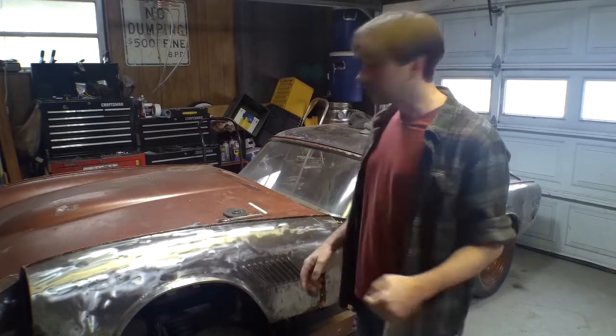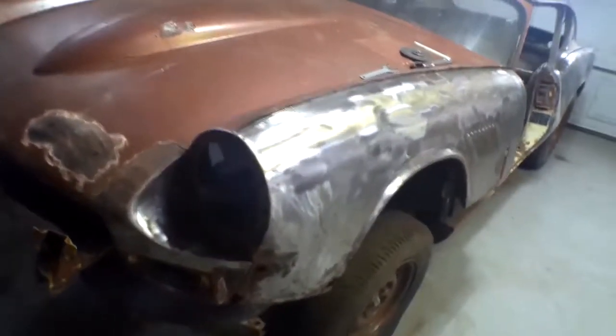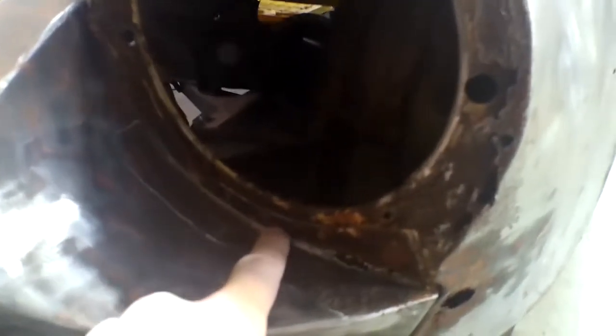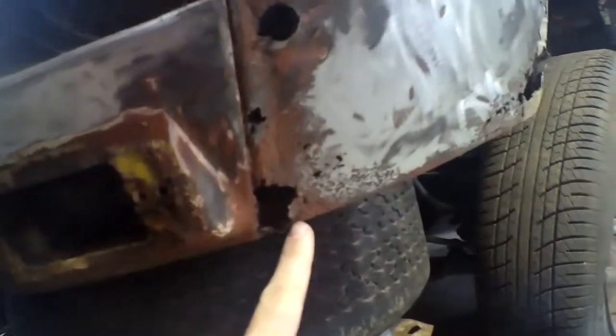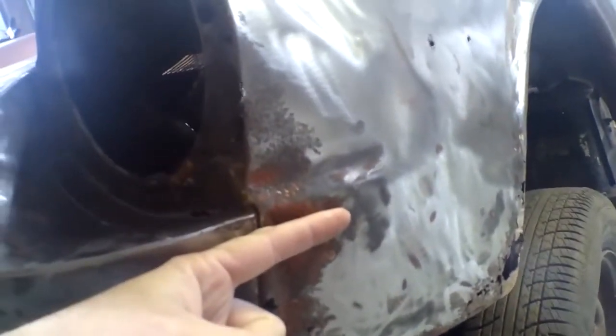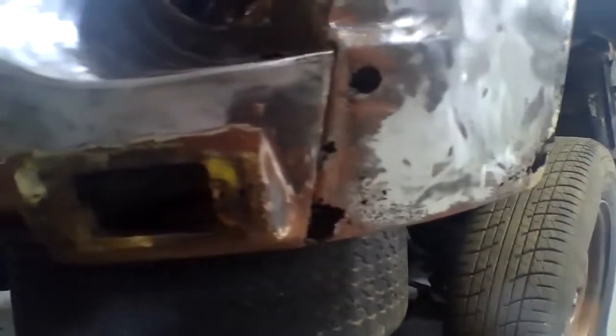Let's take a quick look and see what's happening here. We'll start here at the hood — or the bonnet as we should say. Looking in here, we've got quite a bit of rust happening. I'm going to be cutting this little piece out here. Later I'm going to be needing to cut and fill this out here. This is looking pretty nasty — rusty. That's all going to need to be cut out. I'm probably just going to stop about this height for now because I want to get underneath and get all the rot from underneath there too.